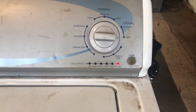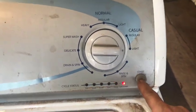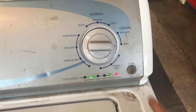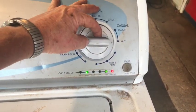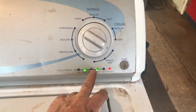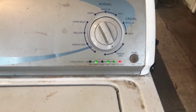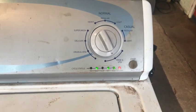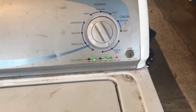I've heard the shift actuator — can you hear it? It's a success — we fixed this machine. We determined that it was a shift actuator. Sometimes it's not the shift actuator — it can be in the wiring harness, so you have to be aware of that. So it's spinning now, but I want to test the agitate mode too. This is in the low spin, this would put it in high spin, and this is in low agitate. One cycle has to finish before the next starts, and the tachometer is telling the machine that it's moving, so it won't go into agitate until the tub stops spinning.